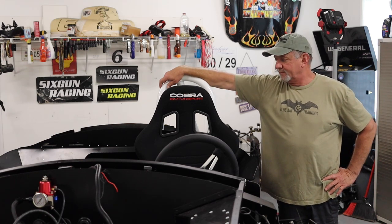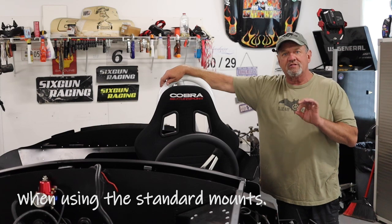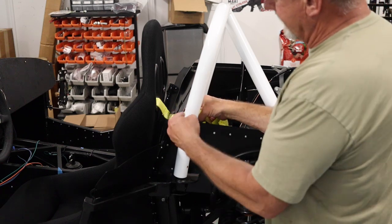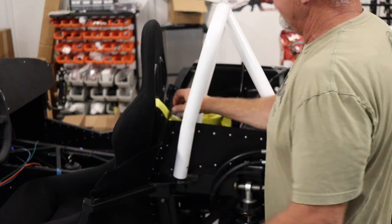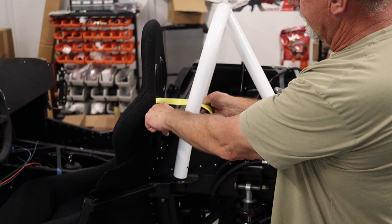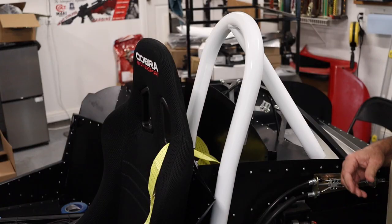That's one of the things I want to talk about today. My conclusion is there is no correct way to mount the seatbelts to be properly installed using a tall seat, or even using the standard seat if you have a tall sitting height. Here's what I'm driving at: it has got a twist to the left and then comes up to the seat back, resting on the seat back — that's unsatisfactory. The angle from the top of your shoulders should be zero degrees down to either 10 or 20 degrees depending on what reference you use. It's not very much, and it's definitely not that.